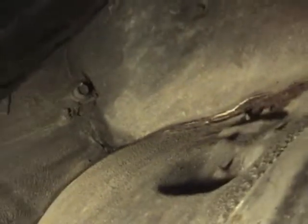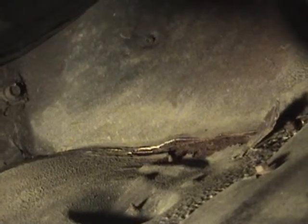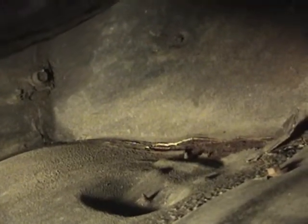For now, I'm probably going to use something like Rhino Lining to replace the factory undercoating. I've seen people do that with these garage restorations, and it works out to be really good stuff, really tough. When I patch up this car, I want it to be solid and stay solid, and that means keeping the new metal shielded from the elements.